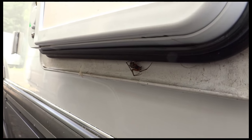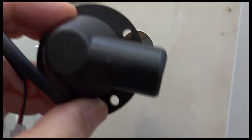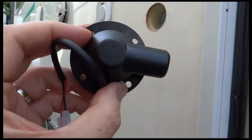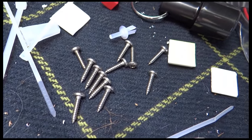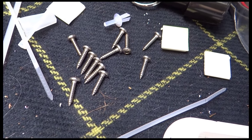I'll have to set him free. Okay, so right, I've siliconed the inside of the hole. Now I've got to mount the fan with the inlet for it pointing towards the hinge. There's four screws that you've got to do that with, and I've just been looking at the screws trying to work out which ones they are, and then I realise they're all exactly the same screws, so it's got to be four of those puppies. So I'm just going to screw that on,